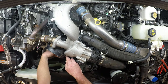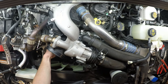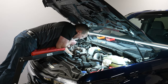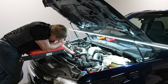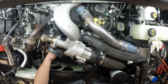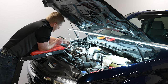The sensor is unplugged, but it's still attached to the lower plenum. We're going to have to get that connector loose so we can get the EGR pipe out. It actually slides out — the connector slides out of a male piece that's clipped below the intake manifold. You want to slide it forward towards the fan and it will come out of that holder, which allows us to remove the EGR pipe.